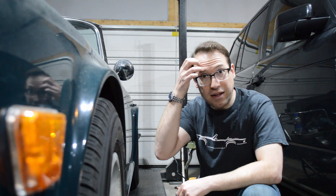Okay guys, that's it. We got back. The alternator was charging right where it was supposed to be — 14 volts and change. Went for a fairly long drive at higher RPMs. Didn't go above that, and honestly it didn't really go below that either. That's exactly what we wanted it to do.